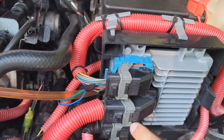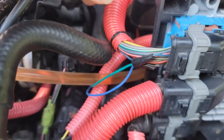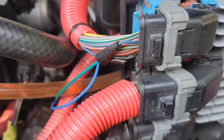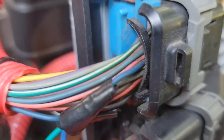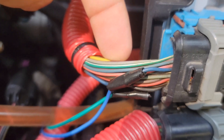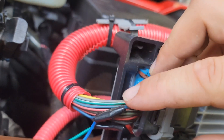So you've got your main harness for the car — this is the scary part. The N2MB instructions tell you not to cut the throttle position sensor wire that goes to the computer — just splice it in — and not to use heat shrink tubing. So before you guys critique me for using electrical tape, I did it as the instructions told me to. The blue wire — you have to figure out which one it is, since there are a few blue wires. I used a Haynes manual, which provided a lot of good information on what all the wires are. The blue wire goes to a dark blue wire: splice those in. The blue wire is the throttle position sensor.